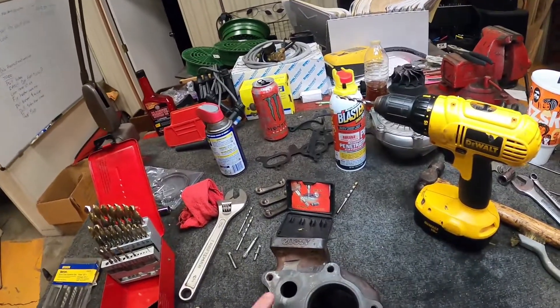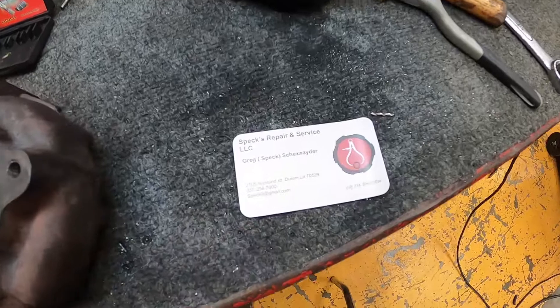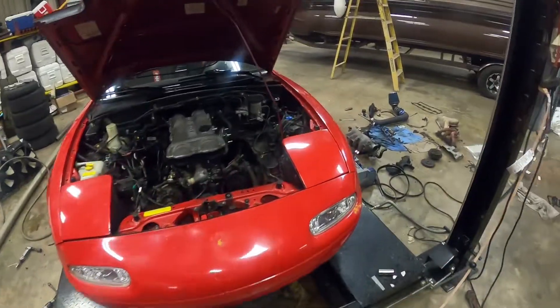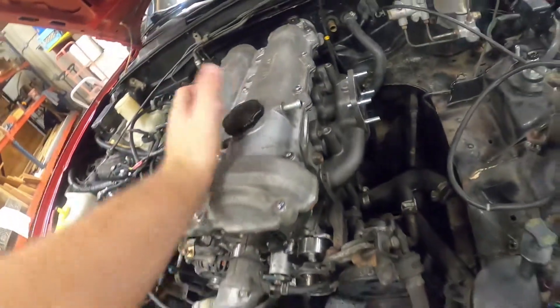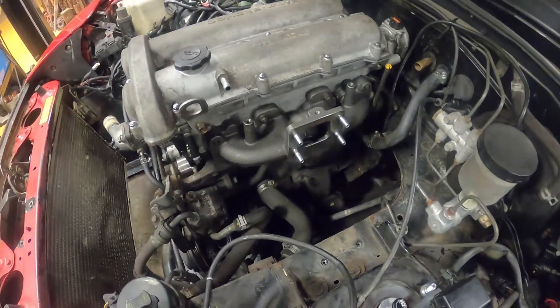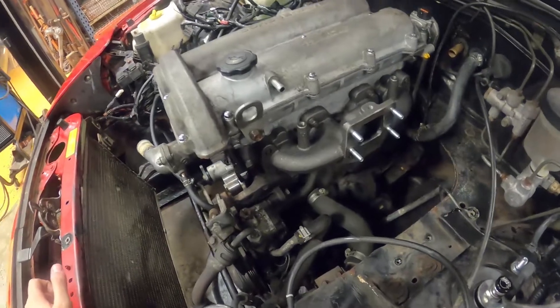It's the next day. Went to my buddy Seth's place, went to his dad's shop, and we got that bolt out - he used his quarter-inch end mill and got it out. That's a hype moment. Seth's dad is in the Lafayette area, so hit him up if you need machine work done - he did me a huge favor. The manifold also came in - check it out. You can see the problem: the studs aren't long enough to go through this manifold. I'm going to see if I can get longer studs or have Seth's dad shave it down a bit.